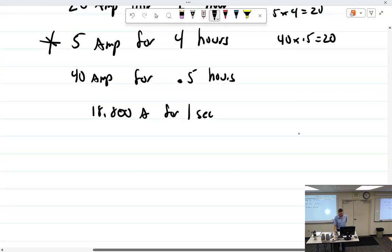And they've got to give it a number. Now, somebody said, and again, I'll come back to this, cold cranking amps. We don't really use that in aviation, which is kind of a weird thing. We really should. In theory, and I've got it written down, it's how many amps you get out of a cold battery, how many instantaneous amps you get to operate a starter, is what you're looking at.